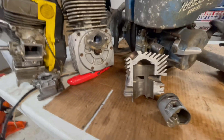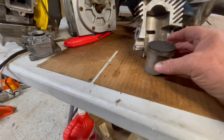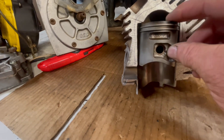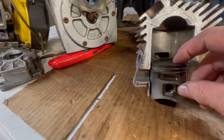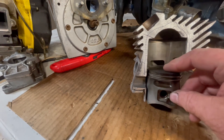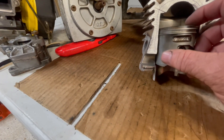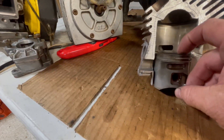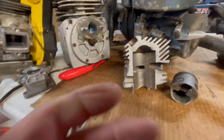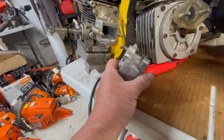Those are your two early-version two-stroke motor types. In today's motors — here's a cutaway of a 592 and a 372 piston — as the piston goes up it lets fuel in through the intake port; as it goes down it pushes it through the crankcase through the transfer ports. It's very important to have a nicely fitting piston, not a worn-out one. When porting cylinders, you never want to go wider on your intake than the skirt of the piston or you won't get the proper charge.